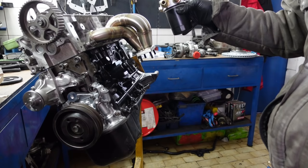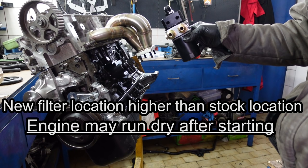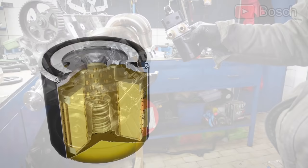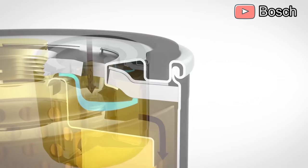A final note: although an oil filter relocation kit allows you to relocate the oil filter pretty much anywhere, some locations are better than others. For example, mounting the oil filter much higher than the sump can result in your engine running dry for a brief period of time when you start it after a few days of it being turned off. Although oil filters have anti-drainback valves that prevent the oil from inside the engine from returning to the sump, these are not foolproof and not completely efficient. If an engine is sitting still for a month or so, the oil will almost inevitably drain back to the sump, and the next time you start your engine, it will run dry for a second or so before the oil gets to all the bearings and internals.